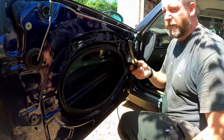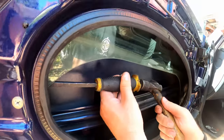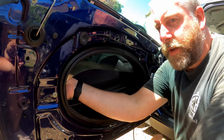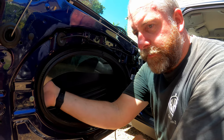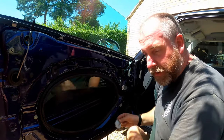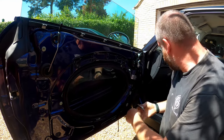The way I'm going to do that is with this — it's basically a pry bar. What I'm going to do is sit it there on the knurls and gently tap with a hammer. Obviously you need to be relatively careful because you don't want to go hitting the window with the pry bar and the hammer — because obviously it will shatter. So there is the first of the knurled wheels off. I'll do the same on the other side. And there we are — that's both the wheels removed off the back of the window.